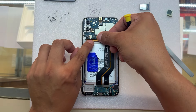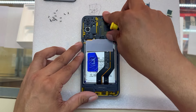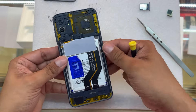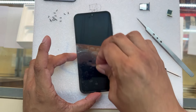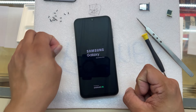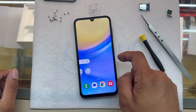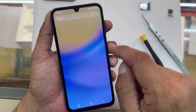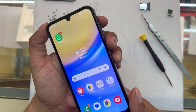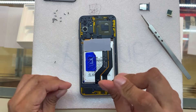It's time to connect the battery. Let's bring the middle frame, connect the power cable and the fingerprint — in this case it's a fingerprint, not a power button. Let's squish these two pieces together and make sure they're closed fine with all the clips clipped. At this point we can peel off the protector film and turn on the phone. Now that the phone is on, we can test all the features — touch every corner of the screen making sure there are no dead pixels and no keys on the keyboard that are not working. After making sure all this is good, all we have left is to put all the screws back in place.